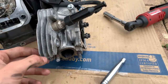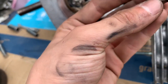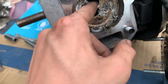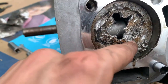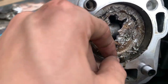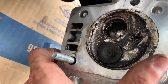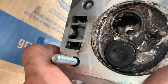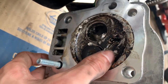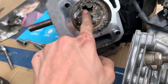Oh, I finally got the head off, and yeah, so I figured it out. The valve is quite destroyed, and the piston looks like it's smacked into it a ton of times and destroyed itself. I mean, it broke right through the piston. Oh god, that whole valve's just gone. When I took off the exhaust, I could see the exhaust valve, so I was fine. But that exploded, gouged the metal a million times, and that's not too good right there.